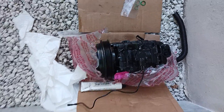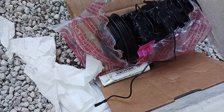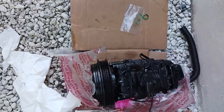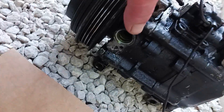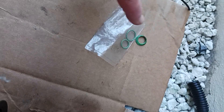I'm getting ready to put that back on and then hook up the hoses again. I got the dielectric silicone compound for the o-rings, because both of your hoses go back on there. Here's where one goes right there — you can see one hose goes there and one hose goes down there. You've got to make sure you put the o-rings back on. I've got to get the old o-ring off, but then you've got to use this stuff right here.